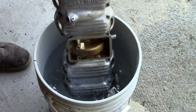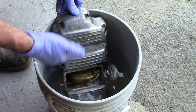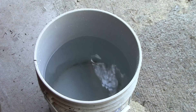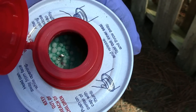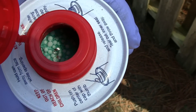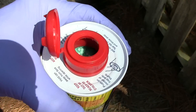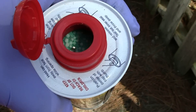I've got the water level in the bucket so that it comes to about the halfway point on the valve cover. That way when I flip it over, it should cover both parts pretty equally without etching one section more than the other. Now we're going to mix in some sodium hydroxide, also known as Drano. Remember when I was talking about the off-gassing? Straight sodium hydroxide won't do that, but Drano and other drain cleaners will. There's a little bit of aluminum in there — those are actually aluminum shavings. When we put this with water it's going to create a gas. The gas is there to help unclog the drain, so this is going to cause some bubbling, and if you were to put this in a sealed container it would indeed explode. Don't ever do that.